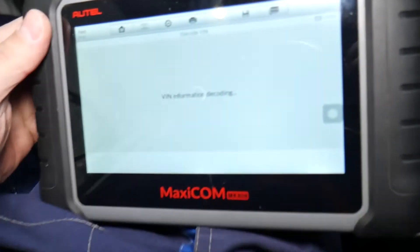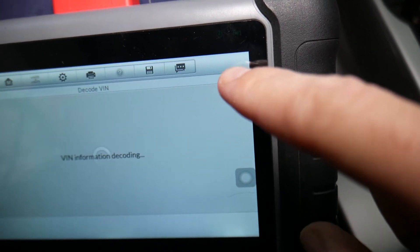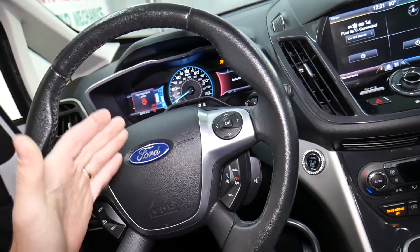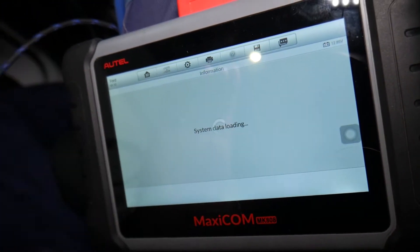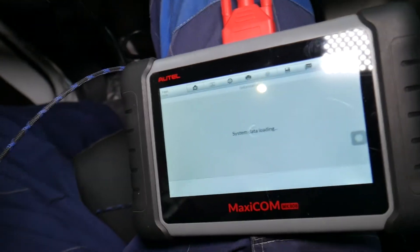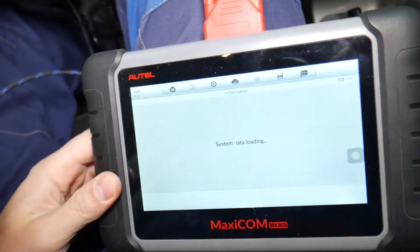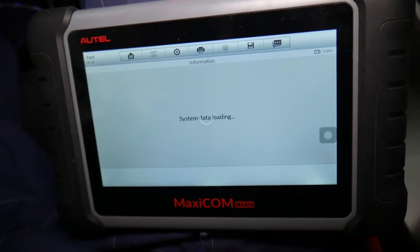Check the battery voltage — you need to make sure your voltage is good enough. Having low battery voltage can activate your airbag light in some cases. The thing about Ford is it's a self-healing system on most vehicles, meaning if the problem was fixed — such as low voltage and then the battery recharged — it should turn the airbag light off. If it stays on, there is a problem. This scanner can read fault codes and see live data from every computer system in the car, making it dealer-level equipment without the programming.